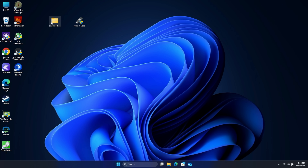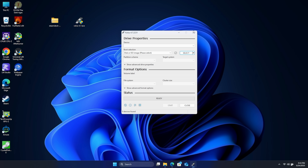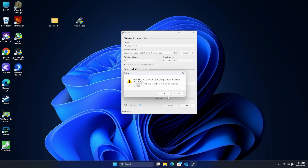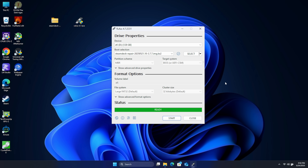I've got Rufus right here on my desktop and the Steam Deck recovery image right here — we're not going to unzip or extract it, just leave it as is. Start Rufus and on the initial startup it may ask if you want to automatically update; you can choose yes or no. At the very top, this is the device we're going to be flashing to. I'll plug my USB drive in now — it shows up right here. Make sure you're choosing the correct drive. Select the Steam Deck recovery image from the desktop and hit start. It's going to give a warning that it will wipe the flash drive completely, so choose OK. You'll get a status bar at the bottom; give it some time to finish. A faster flash drive will work so much better. Once it's finished, the status bar will read 'ready.'